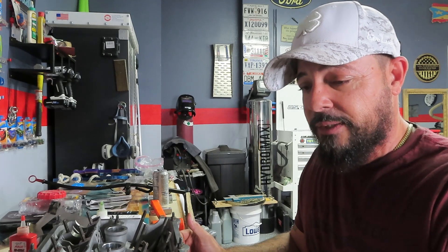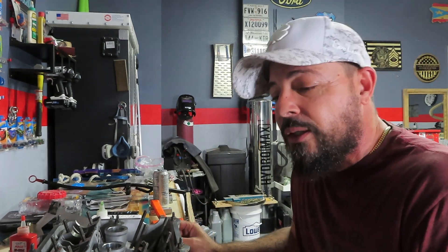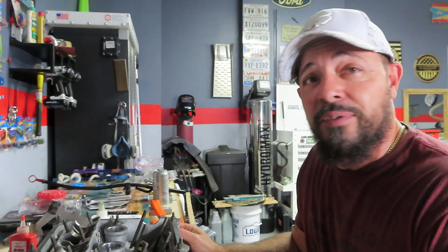I hope you guys like the video and how easy it is — that you can come up with your own tools to get the stuff done. I was checking all over and did see a tool that looked just like this one, but it was expensive. I think five bucks is the most I have in here, and I was able to make it work so my daughters can install all the springs and everything after they put in the valve seals. If you got the money to spend, go ahead — but if you don't, get it done.